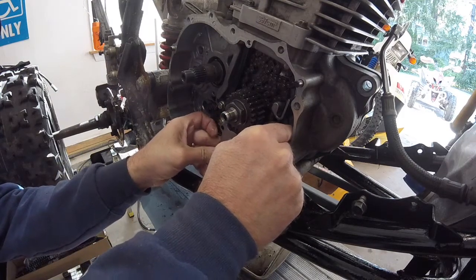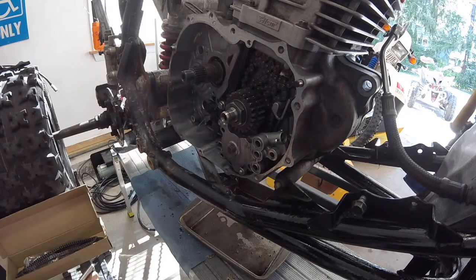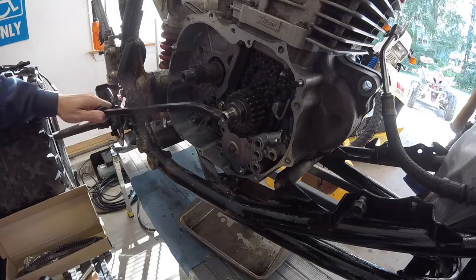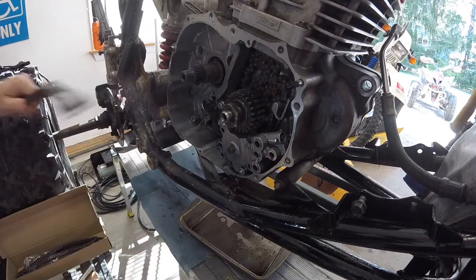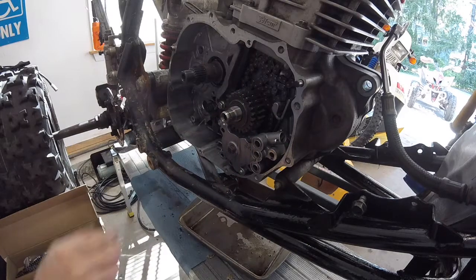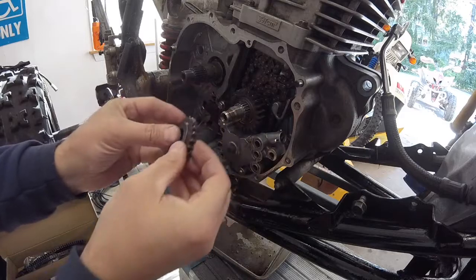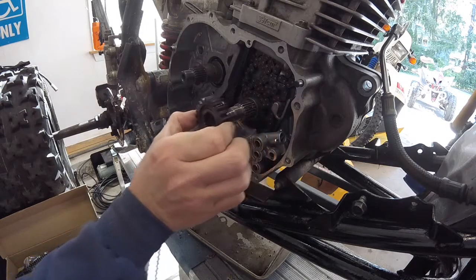Without removing the gear, we cannot. So that is not fun. Alright, let me pause for 1 second here. Alright, we're back. I'm going to stick a pry bar in there so that in case this thing spins, I don't lose a finger. And I'm going to hit it with my impact. There we go. And it's marked out, so we'll remember how that went back on.